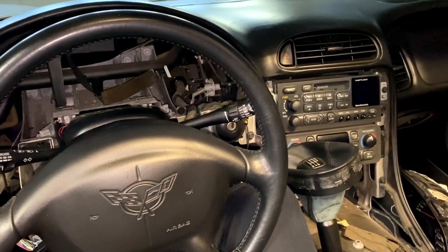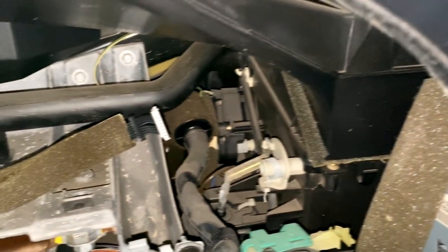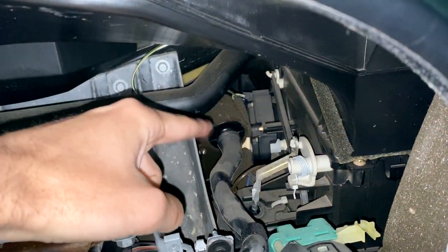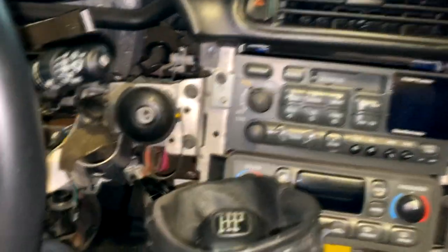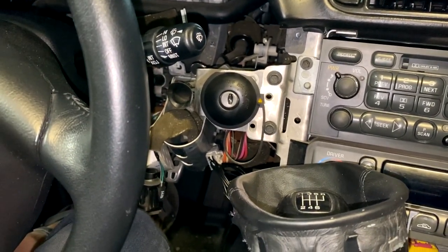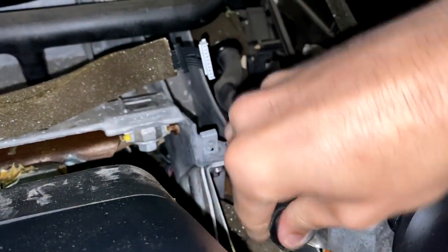Now that we have all this stuff out of the way, let's get to the point of this video — accessing and replacing that HVAC actuator, which if I come around the steering wheel, you guys can see is right back here held in with a couple screws. However, before we do that, we need to remove one major thing. It's actually this duct right here with a little bit of a muffler on it, and that is for the ambient air sensor for the inside of the cab of the vehicle. That sensor tells the HVAC system what the temperature on the inside of the car is and how to fluctuate your automatic climate control system. So to go ahead and remove that duct, it looks like it's just held in on a bracket right here by the ignition.